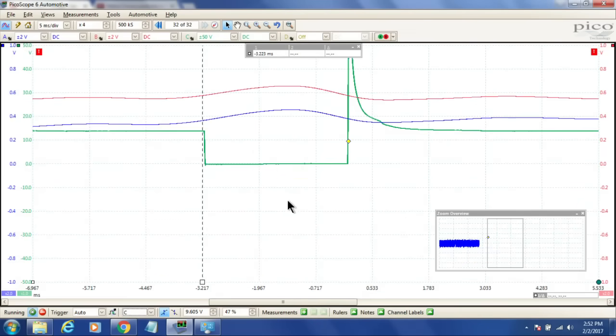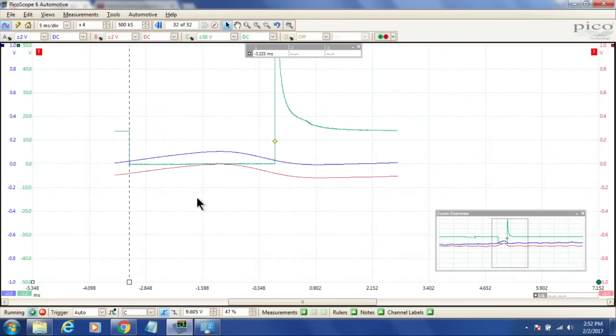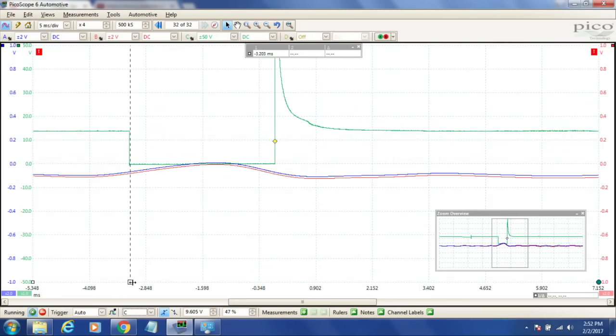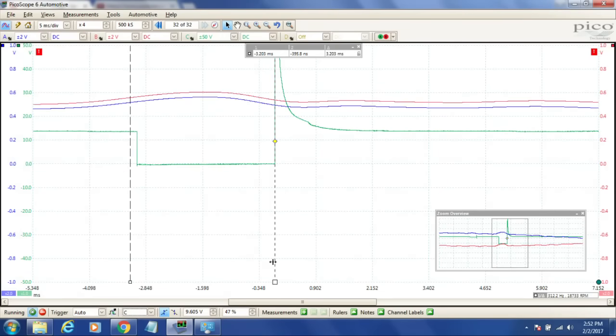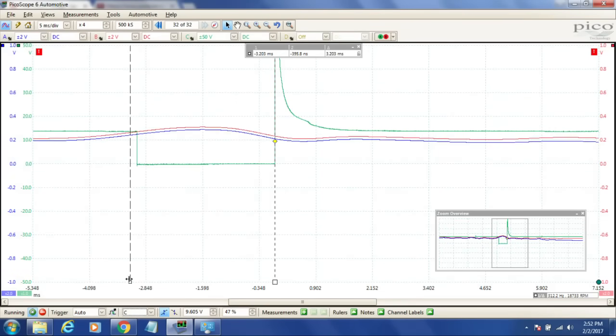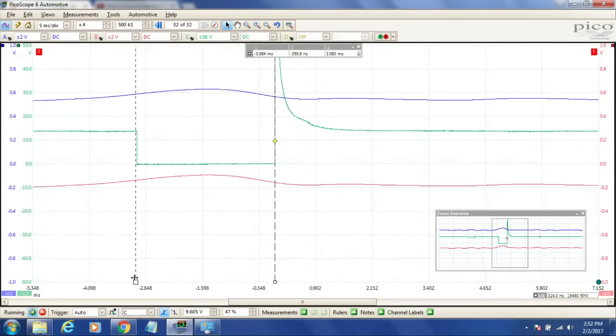All right, so I'm going to measure that amount of on time of the injector. And actually, I'm going to take the mouse wheel. What's nice about this scope is that I can take the mouse wheel here, and I can zoom this in really easily. So I'm going to throw some cursors up here, and it's going to automatically measure the on time of our injector. And I'm going to try and get it right to where its happy spot is here.